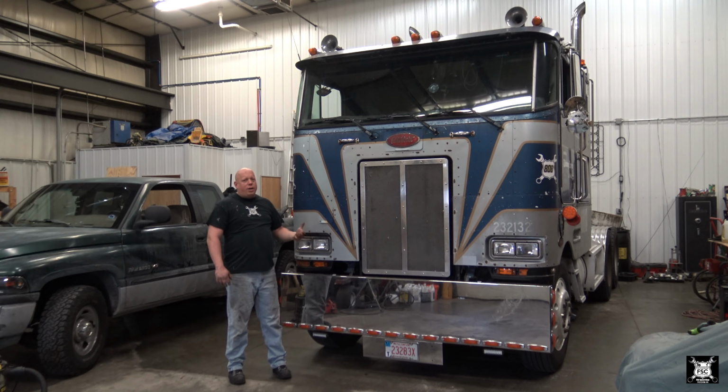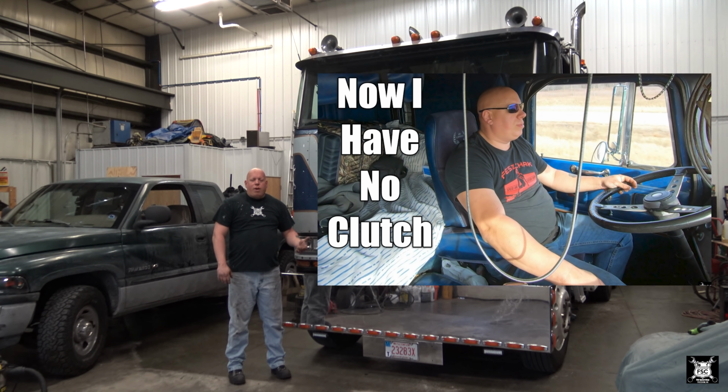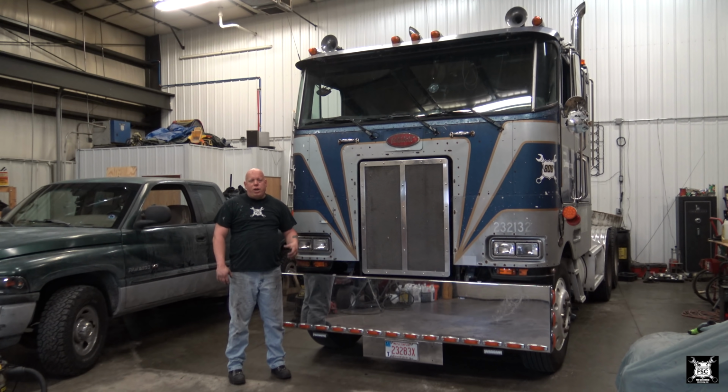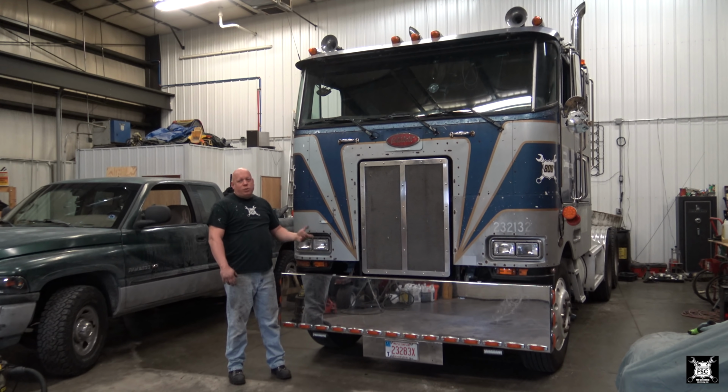Number one, in the middle of that video, you should have seen I lost my clutch. The clutch cable snapped. The clutch functions, but I can't release the clutch. How you remedy that is you turn the engine off, stab it in gear, reach over, turn the ignition on, and refire the engine. Once it fires up, now you float the gears to come to a stop. Just simply pop her in neutral, bring her to a stop, cut your engine off, wash, rinse, repeat. It is a way to do it.